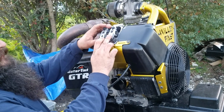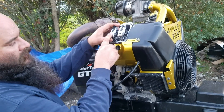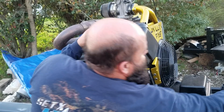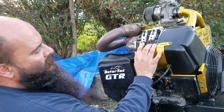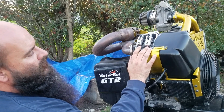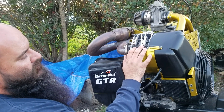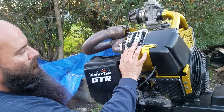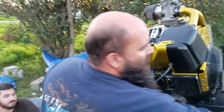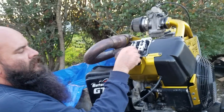We just set the intake. Now we're going to do the exhaust. The exhaust just started to move, so now we're going to roll the prop. The exhaust is going to roll through. As it's coming up, the intake is going to start moving, then roll through. As soon as the intake stops moving, we stop. Right there — stop. Intake stopped moving. Now we can set the exhaust.